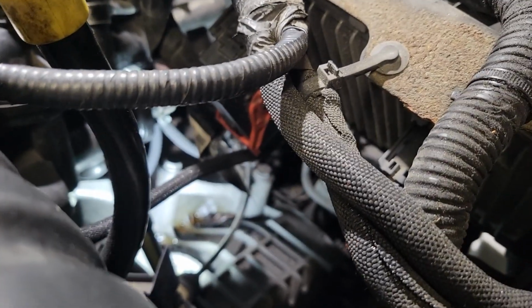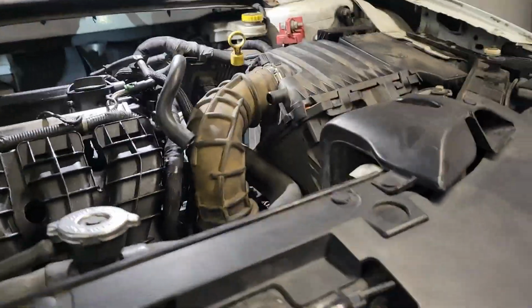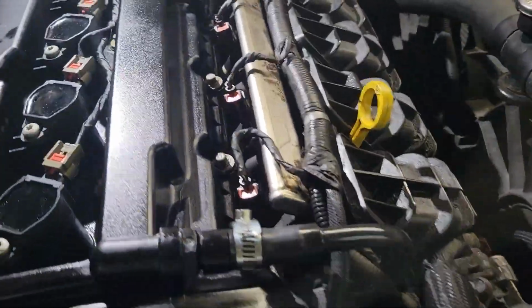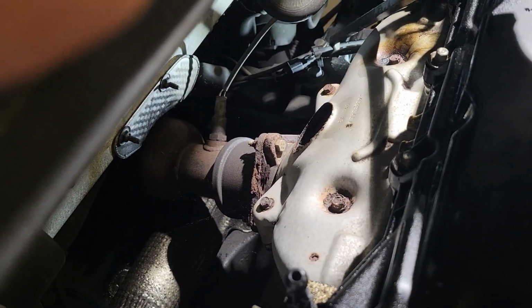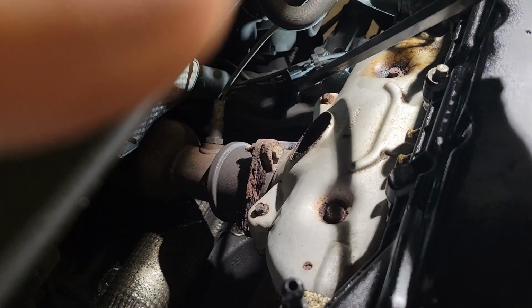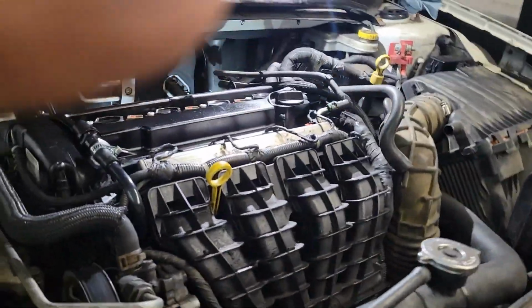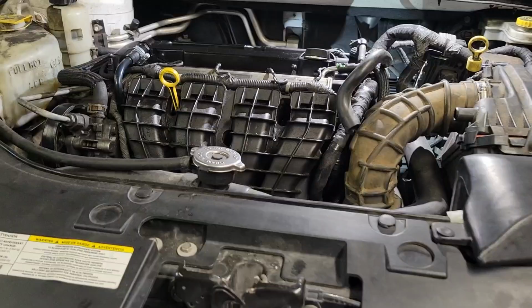You can see two bolts down there by the light, but from the other side you get better visibility, though it's a little bit harder, longer reach. What we're going to be taking off eventually is this plate right here. There are 3 bolts on the top and 1 on the side right where I'm touching. There's one of the bolts right there, and one on the inside. We're going to have to get that out of there just for maneuvering room for that back engine mount.